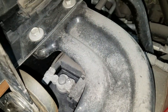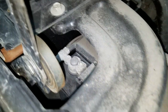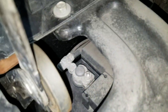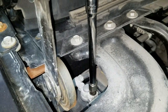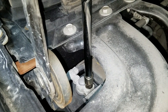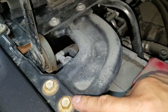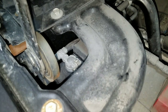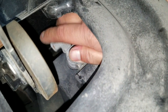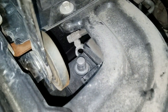We are in the engine compartment as you can see here. Here's the battery. The next step is to disconnect the battery for five minutes or so. You want to do it from the negative terminal, which is the one in the back on this truck. You'll need a 10mm socket and probably an extension to reach it. Loosen that with a ratchet and then remove the terminal, keeping it off the battery until five minutes has elapsed. If you'd like, you can remove the reinforcement bracket — I believe those are 13mm heads, remove all four to get the bracket out of your way — but in a lot of cases you can just reach underneath it and wiggle until it comes off. We'll let this sit for five minutes or so and then reconnect the battery.